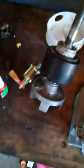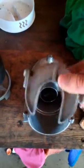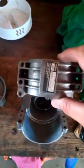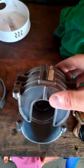I have another shaft and coupler that I'm going to replace what I already have in there with. It's another shaft out of another ski. And I have the top part. You can actually buy a kit on eBay where they'll sell you this bottom part, this top part, and a tube of 3M 5200 sealant.